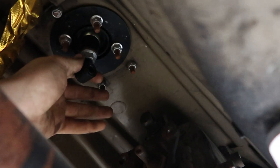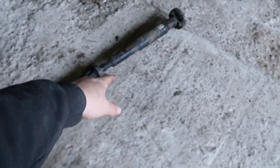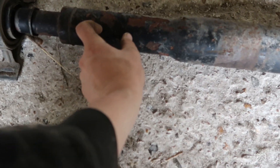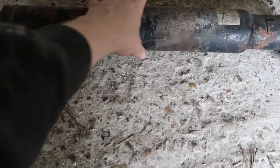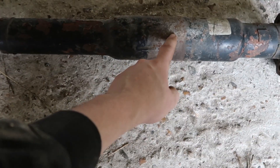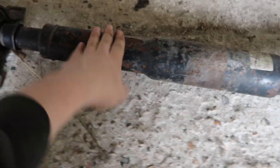It's not too bad underneath. I need to take this prop shaft out and make the gear linkage — cut it and weld it so it's level. Here we have the prop shaft for the ZF. This flange here is much bigger than the one on the Getrag, so if you're going to run the ZF, the rear part is the same but the front part is different. I'm going to have to chop a section out and get a sleeve over it.